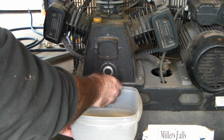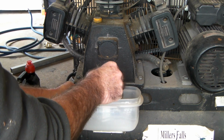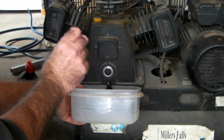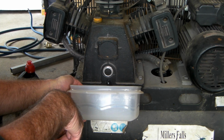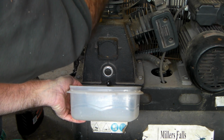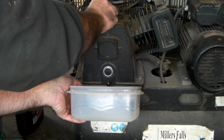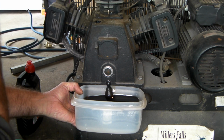Right, so I've undone that. So we're starting to do the rest by hand, and we'll let the oil come out. Then we're holding that container up there a little bit, just so we don't get too much backwash there. As you can see, that oil is pretty damn disgusting. Wow. And what I also do is just take the filler cap off the top, so we haven't got so much suction in there, so the oil runs out a bit better. We're still coming out with oil, guys.